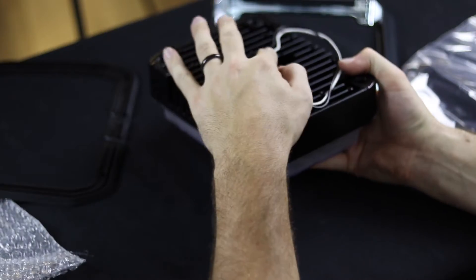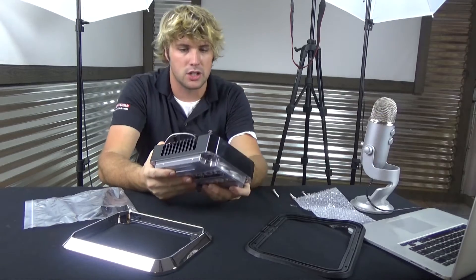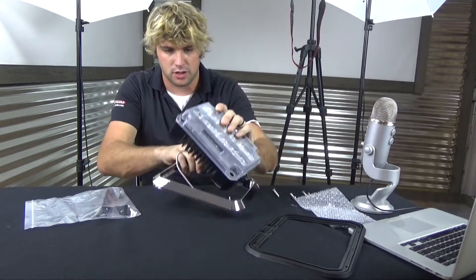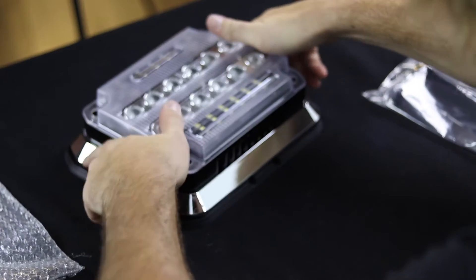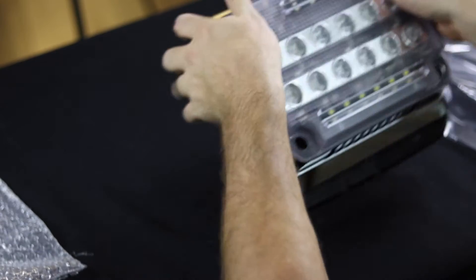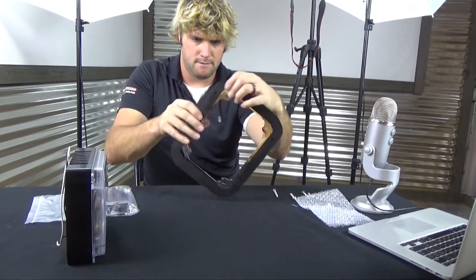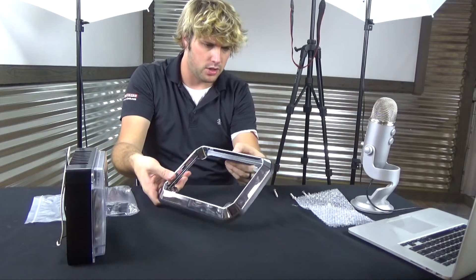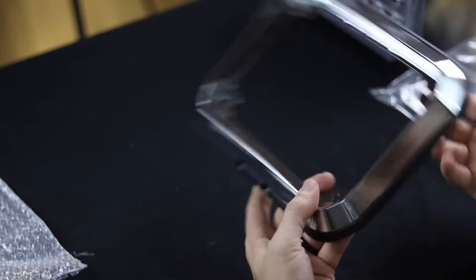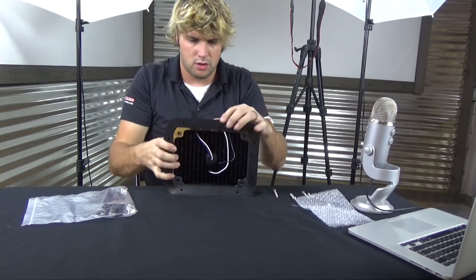On the backside of this fixture, we've got this mounting plug — this actually goes through the body. The durometer is a little bit lower than the original prototypes, and that lets it squish a little bit more into place and keep more tension on the bodies. This mounting gasket — the fixture goes into it, and then from there it goes into here. This is the actual gasket interface, which all lines up nice and neat, and then that thing can be installed on the body. See at the bottom right here, these are two drain holes so that if any moisture or water gets behind the fixture between that and the body, they'll drain right out of it.